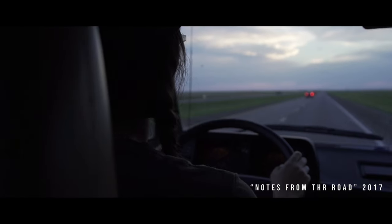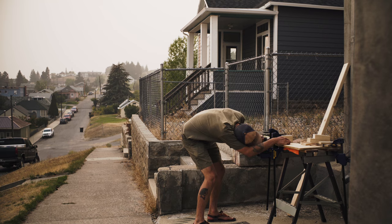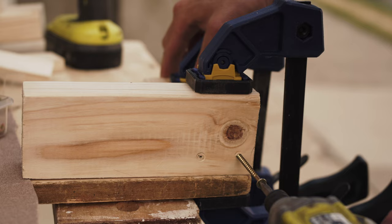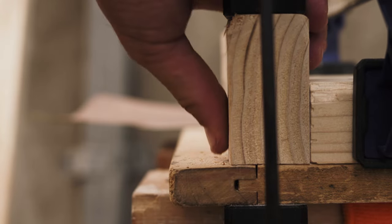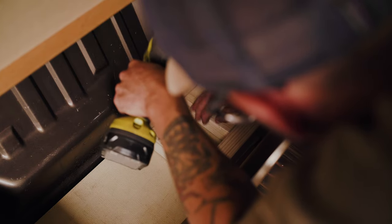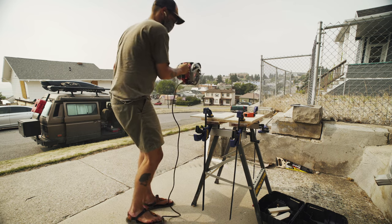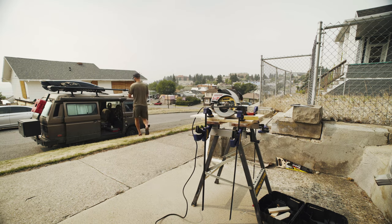Fast forward to the winter of 2020 — we're living full-time on the road and suddenly public workspaces became far less hospitable and in many cases were completely shut down. These starter lead-acid batteries are meant to be drained just slightly by the amount it takes to turn over the starter and then immediately recharged by the alternator. When you draw them down below 50% — which in terms of voltage might only be one volt, down below 11 volts starting at 12 — it doesn't take long to kill one. They stop being able to hold a charge and often just die completely.